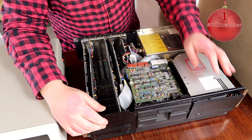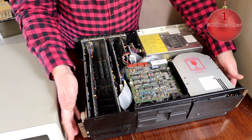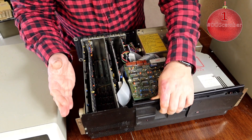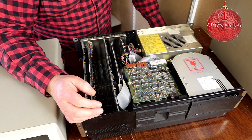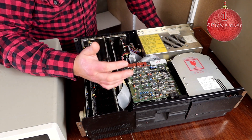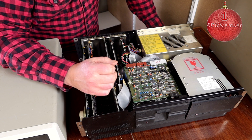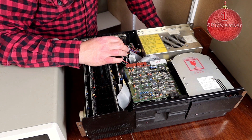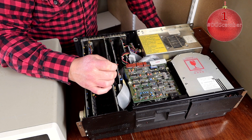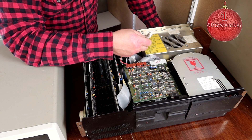Both of them have the original hard drive — the Seagate mounts — and they have the five-and-a-quarter inch IBM branded floppy drive. They also have the original IBM cards. The main difference on the motherboards between the 5160 and the 5150 is that the 5160 has eight slots on the motherboard and also has more memory on board as standard.